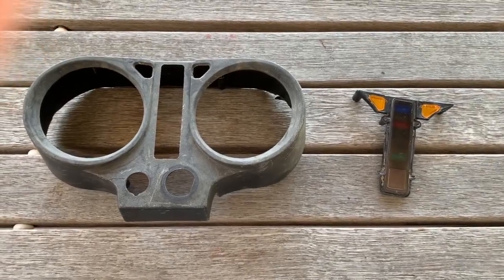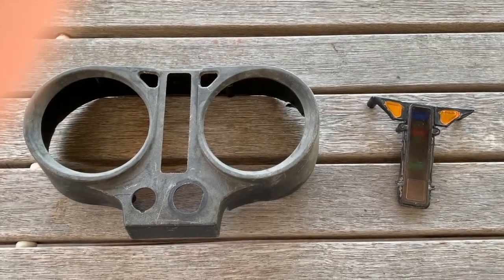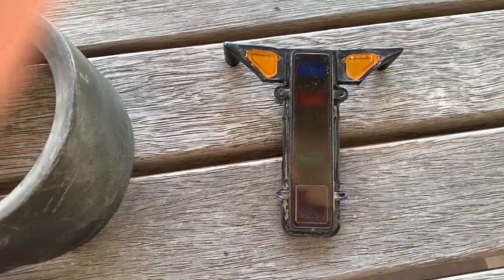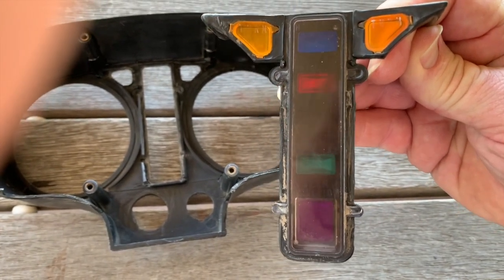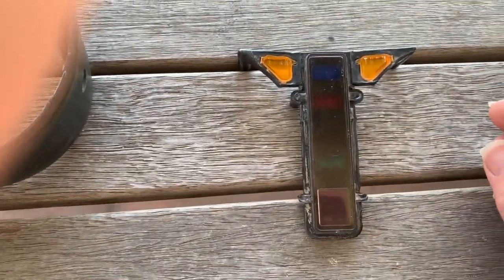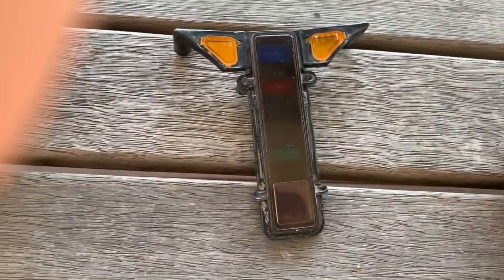The dash is in reasonable condition. I've had to use a speedo off another set from a GS850 — that's kilometres an hour — and swapping that over, then pulling this apart to give it a clean. The white lettering on these things has come off. It basically clips in there quite tightly, but there's actually dirt inside behind that perspex piece. I've tried various methods of soaking to get it out, but now that I've managed to get this out of the unit, the perspex piece actually comes off.